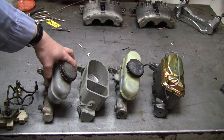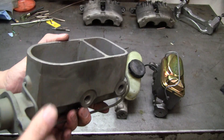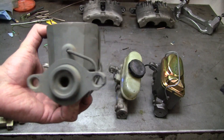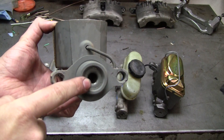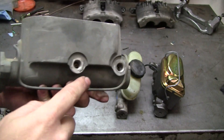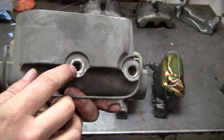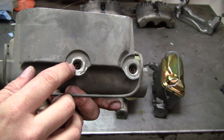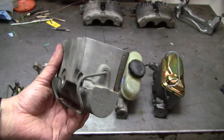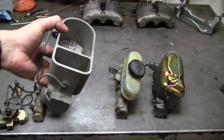If you've got a 79 to 86 car, you've probably got a master cylinder that looks a lot like this one. This is actually off an 85 Lincoln Town Car — it uses a one-inch bore, which is larger than your 79 to 86, but it still has those standard ports. Looking inside, you can see a cone for the tapered brake line to fit on and again the standard threads. This would look very similar to your 79 to 86.